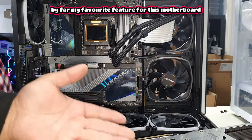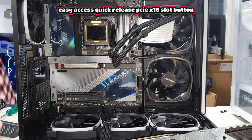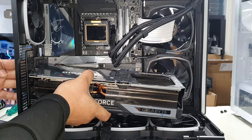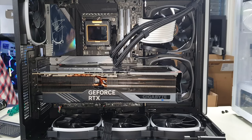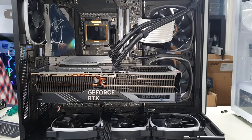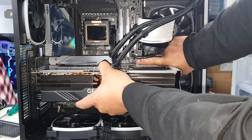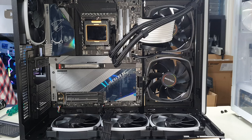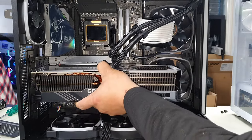This motherboard is a little different in how you release the GPU. Usually you release a tab at the PCIe slot, but on this high-end board you have a tab on the side — which is so great because most of the time it's very hard to press the tab when removing a GPU. Line up all your slots, once you feel it aligned simply push straight in and hear it click. Then you know your GPU has been seated correctly. To remove it, use the side tab — press on it, hear the click, and give it a tiny wiggle and out comes your GPU.